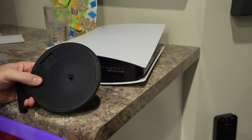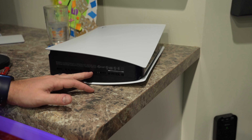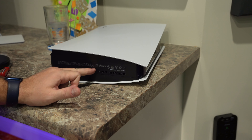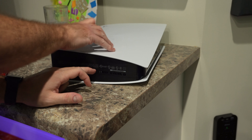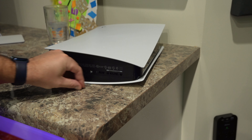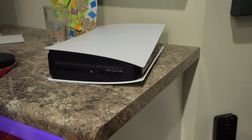Now this is where it gets tricky. I made a mistake there — I twisted it back, and that's not going to work. Because what's going to have to happen: see this little circular piece in the bottom of the PS5, you've got to pop that out. If you've got a little bit of a fingernail you can probably pop it out; if not, you may want to get like a little kitchen knife or something. That's important, because that's where the screw's going to screw into.